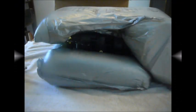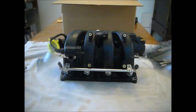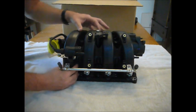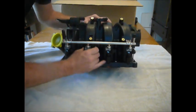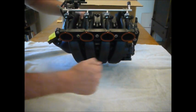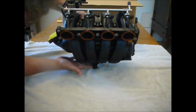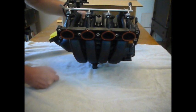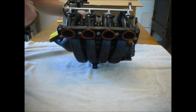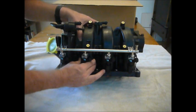This is how it's packed coming out of the box with a foam casing. This is the metal fuel rail. This is the approximate orientation when it's mounted in the car, looking from the front. The four cylinder intakes are down here with a rubber gasket, and I'll go through each of the connections so you have some idea of how many things to look for when you disconnect and remove your intake manifold.